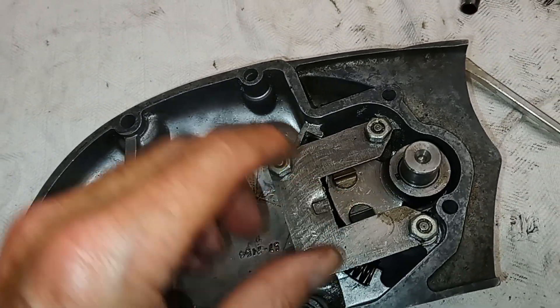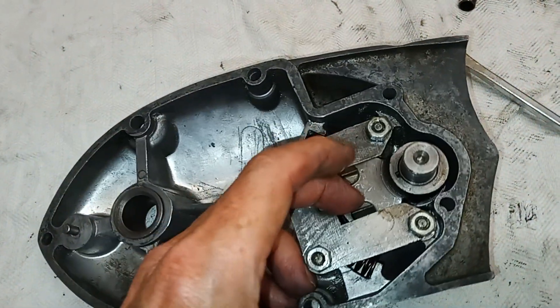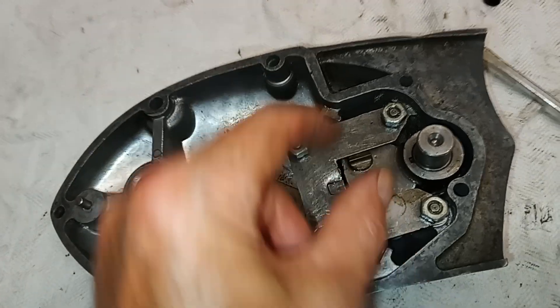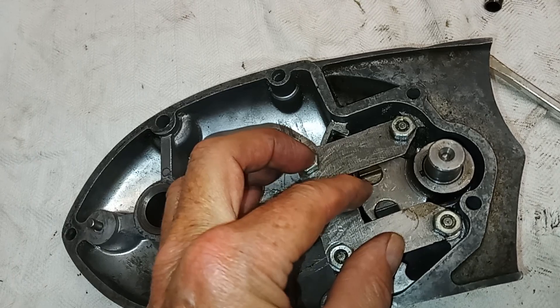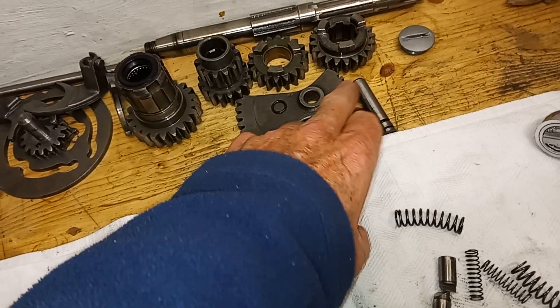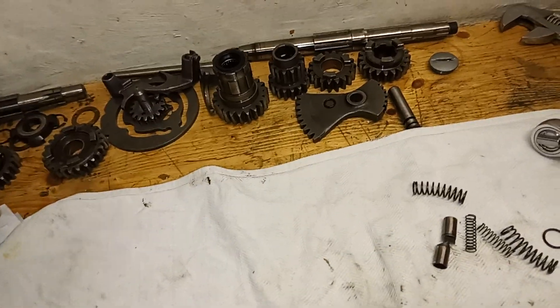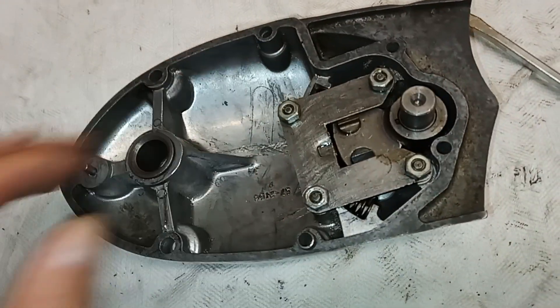When the gear change turns, the plungers can move underneath the striker plate. One moves under the striker plate depending on which way you move the gear lever; the other one comes out and can spring out to engage with the teeth on the quadrant, which then serves to move the gears. So we're all sorted there.